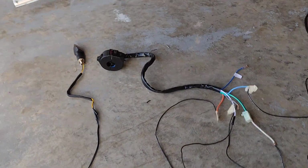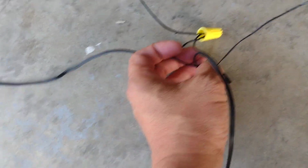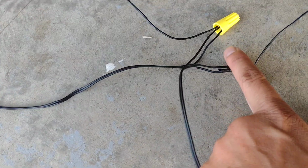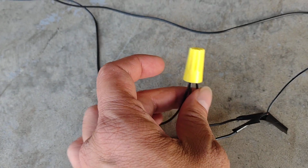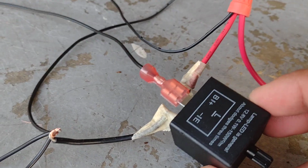First of all, you can connect this one right here. The yellow is positive and the black is negative, and same thing on that. And you put positive, connect one side together, okay, here, and both lights together, and negative. And positive, of course, you take from the yellow, go out, and yellow, go out on this one, okay? That's positive. On this side, negative, you go and connect that into negative right here. Negative.